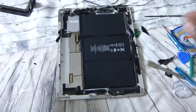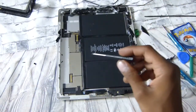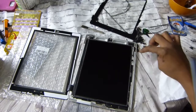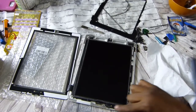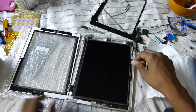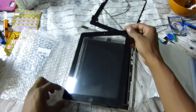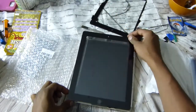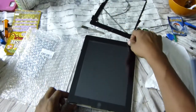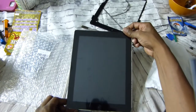I'm going to pause the video to clean around these edges before replacing the other one. Now that we've got the edges cleaned off with all the glass removed, set the digitizer and everything back in there before finally putting it all back together just to test it. Set your digitizer, connect your ribbon, set this back on top, and hold the power button to turn it on.